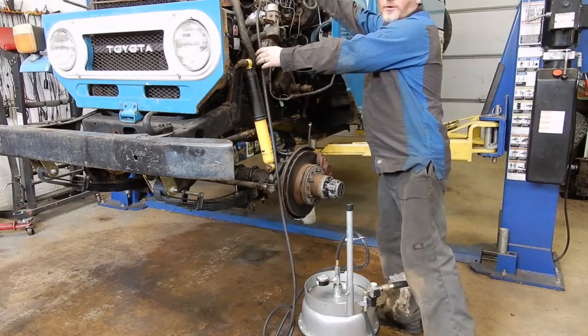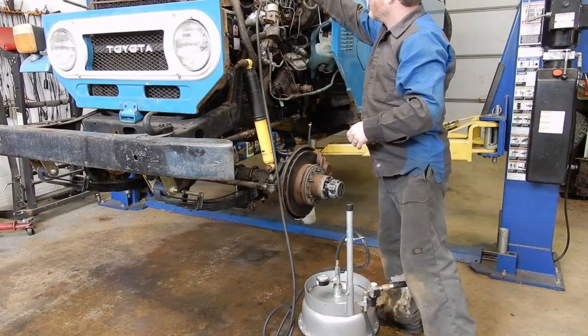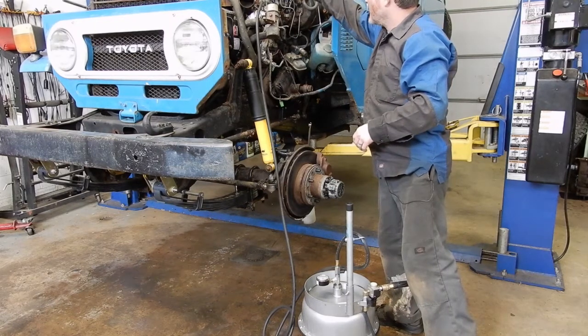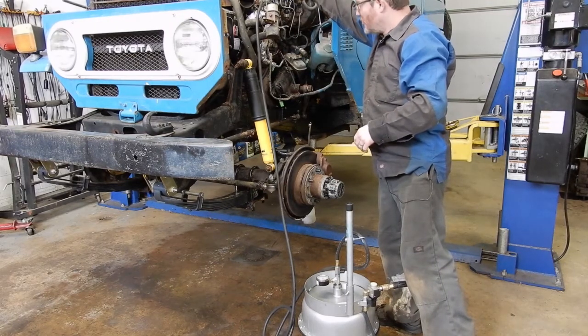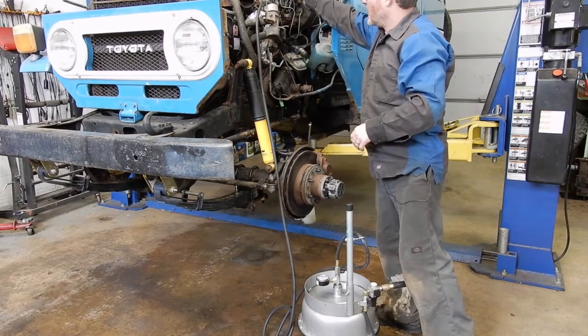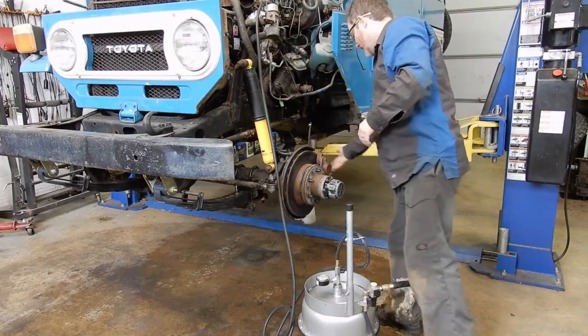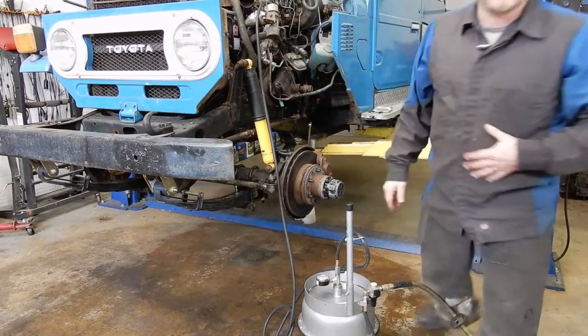And on the old cruisers, we've got one of the universal clamp-on adapters. Not a huge fan of these, because if you don't get them just right, they'll leak as you're bleeding, as this one did, as you can see by the freshly mopped floor.